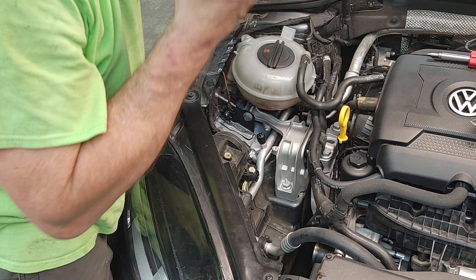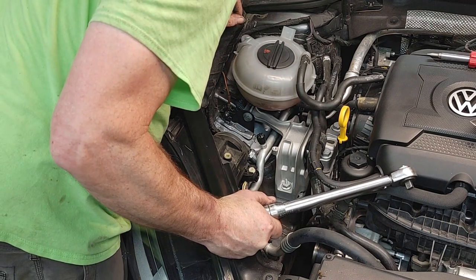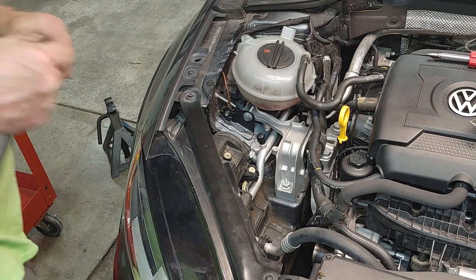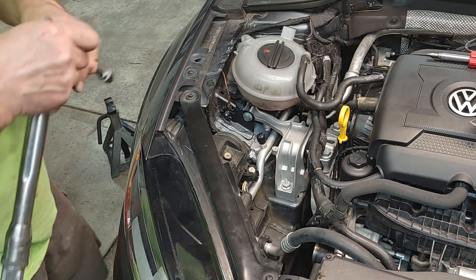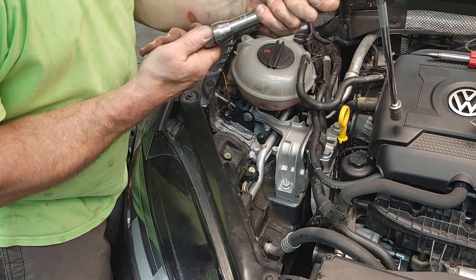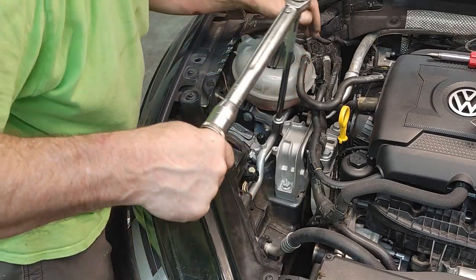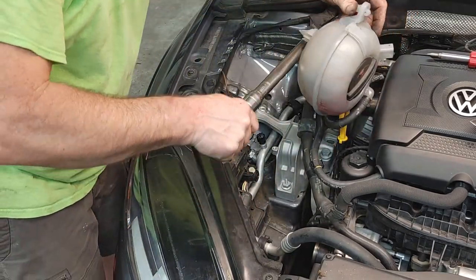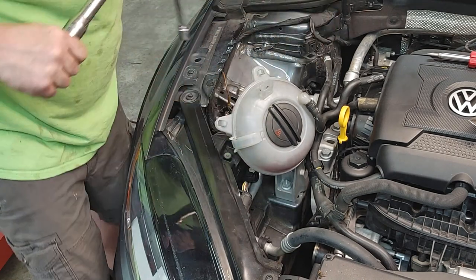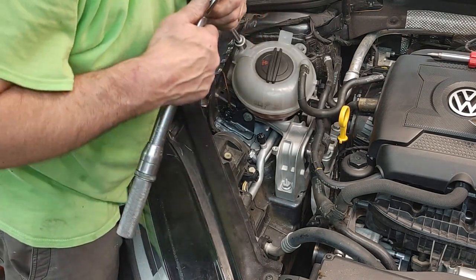Grandpa glasses on. Trust my torque wrench. Okay, we're going to do these first. Okay, engine mount to frame rail, 30 foot-pounds, and a 90 degree turn. The torque on these isn't that high because this sits right on here and it really just needs to hold it in place because it's sitting on top of it. I'm going to take all these down and then do each one a quarter turn.